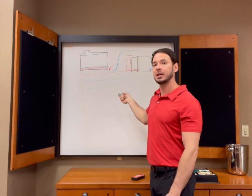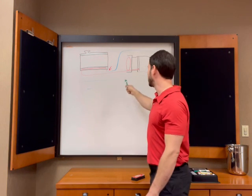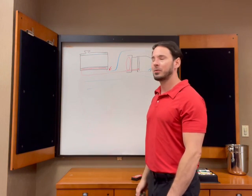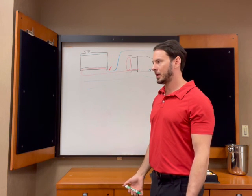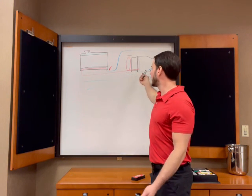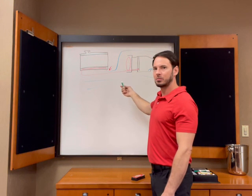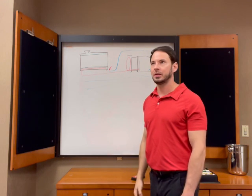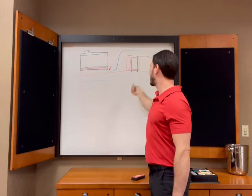If you are taxing the engine on an SVX, you're going to be driving the car really fast, which means more airflow across the radiator. I mean, think about it. The car will shift out of third at like 120. So even if I'm flooring the car, I'm not going to be stressing this torque converter. That'll heat it up, but not to any extreme. By the time I've had sustained stress on the torque converter, the car is going ridiculous speeds. Before you can even measure a heat increase in here at all, the car is going 90 miles an hour.